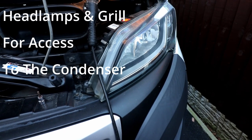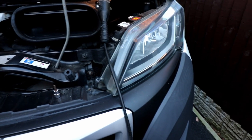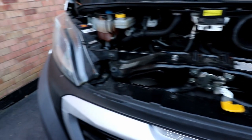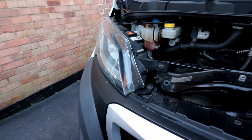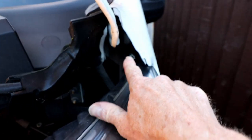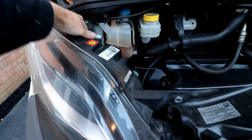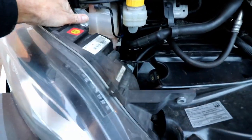The first task is going to be removing the headlights, because they come out really easily on a Torx 30 bit — probably the same on both sides. Once you take that bolt out and the bolt off the back, to get the headlamp out you literally just slide it to the right and out it comes.